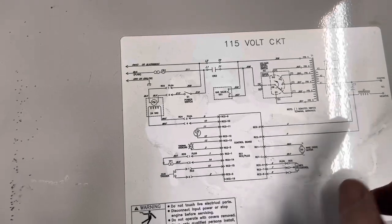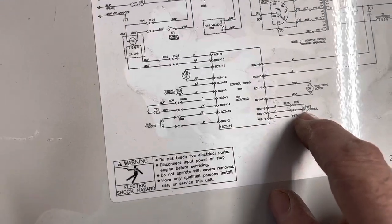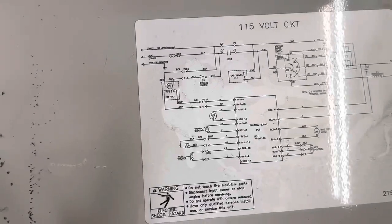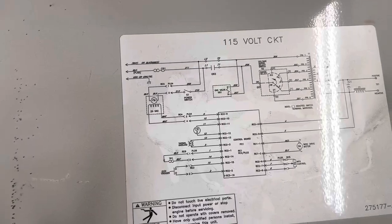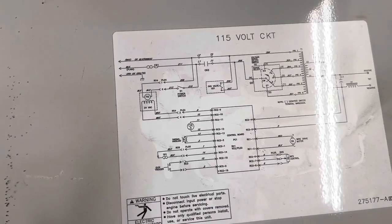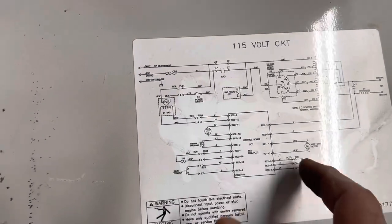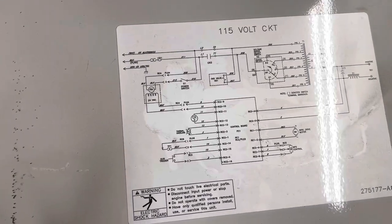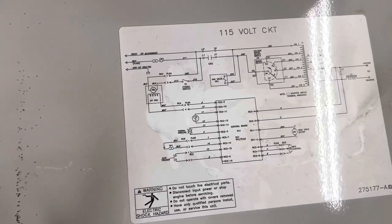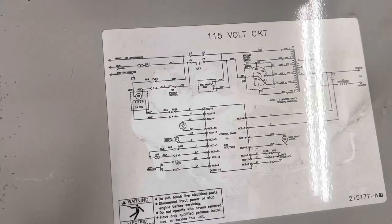It could also be, well, that's probably built into the wire feed control. Could be a problem with that. But the way it just quit, I kind of have my doubts. I wish I knew for sure what voltage that wire drive motor was. We could just hook some direct voltage up to that thing and see if it turns. But I don't want to get it wrong and smoke that motor if it's not smoked.